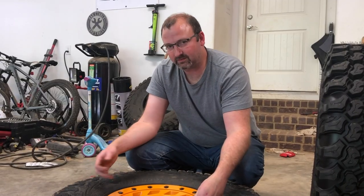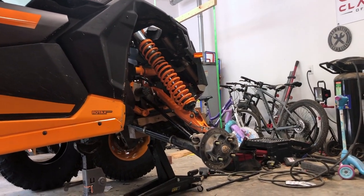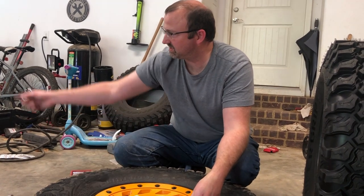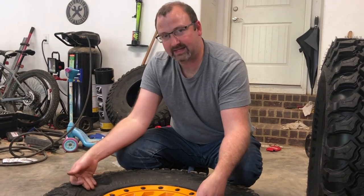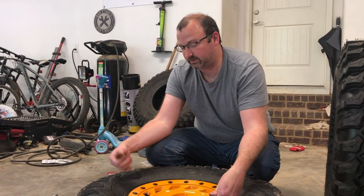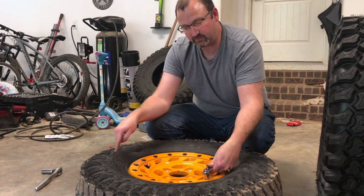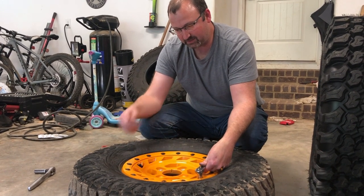As you can see, I've got the front tire off. For those of you with your sway bars disconnected — unless your jack is much taller than mine, you're going to have to reconnect your front sway bars to get the tire off. I couldn't get high enough to free the tire from the ground; full extension with a board was just barely enough — this thing has amazing flex. Once the wheel is off the hub, it's a good time to inspect your brakes. Mine still look fine. Next, take the valve core out and let the air out of the tire before doing anything with the bead lock ring — you don't want to take that ring off while pressurized.